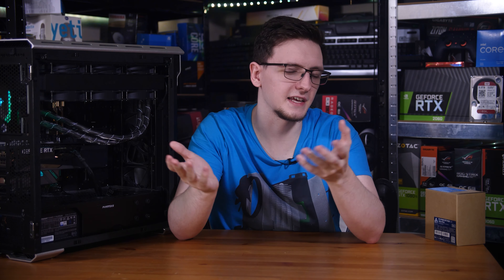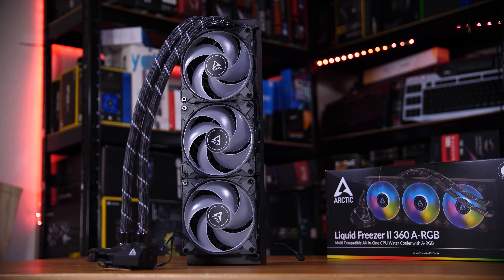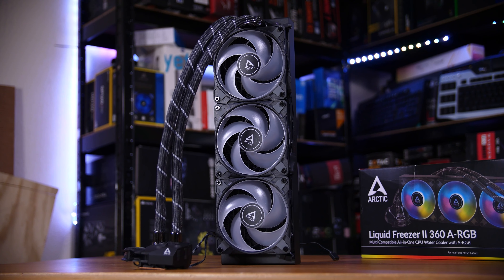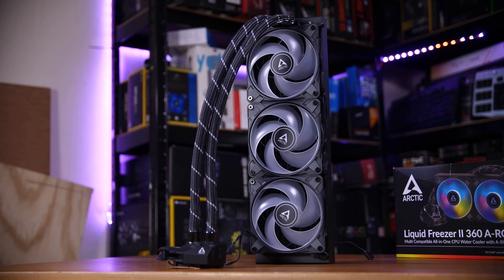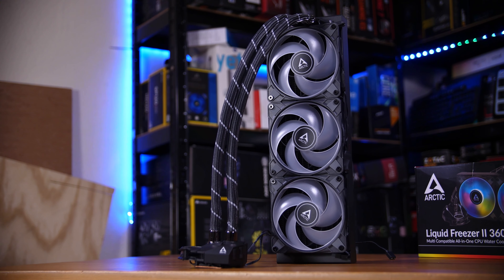Now, I can already hear you rushing to the comments to call me a moron — and let's face it, it's probably the right thing to do. I didn't control for fan speed. But here's the thing: if you watch my review of this cooler, you'll know that it is absolutely silent. Even with almost 200 watts being pumped through it for over 30 minutes, it's still barely taking over. So adding more fans — while they will be able to run at a lower RPM thanks to more blades actually blowing or sucking air through the fins — the added noise of just having twice as many fans counteracts any benefit to the reduced RPM.